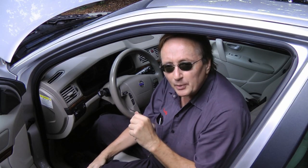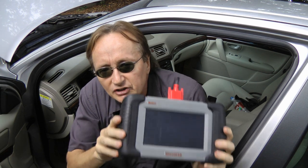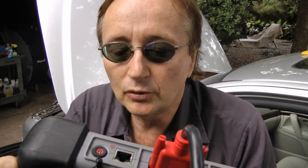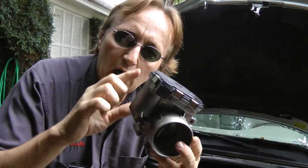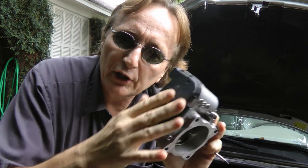Now many times when they break down, you get a light on the dash that says something like 'reduced engine power.' Unfortunately, to analyze these systems you need a pretty good scan tool, and I hate buying this equipment — but I have to, the way they build them nowadays. When I hooked this tool up to this Volvo, it had four codes: P1167, 92CD, 9200, and 9220. Those are all codes that have to do with the problem in the throttle assembly here — it's all computerized.